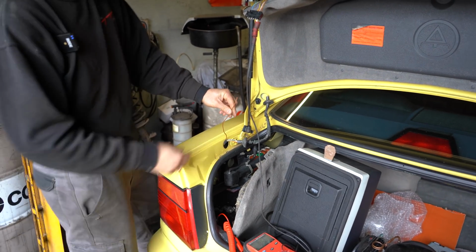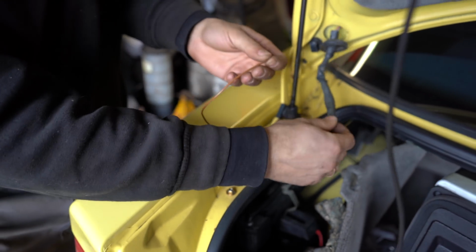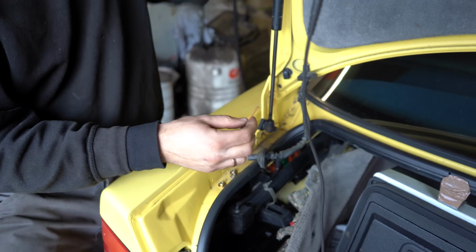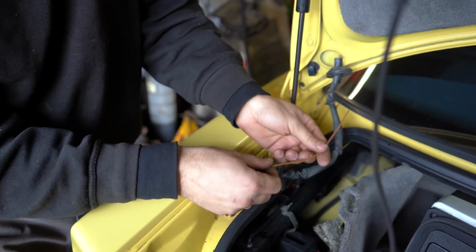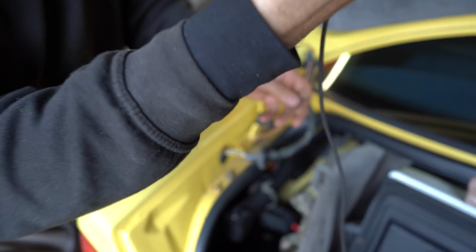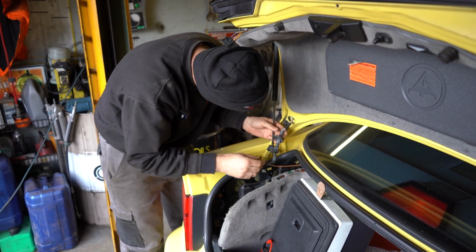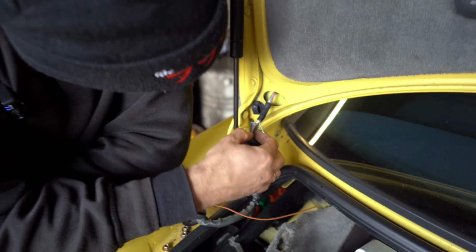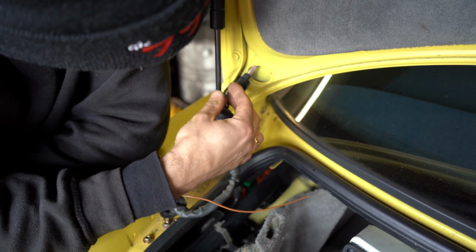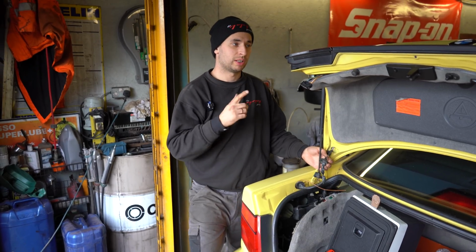Here it is. That was funny. I was wiggling the wires and everything seemed to be fine, but yeah, broken wire. So it was literally somewhere in between there. Easy fix then. Oh, there is more than one wire broken. Just thinking, how come it didn't catch on fire? Touching each other. But no big deal. So that rear fog light message was really bugging me. So now I gotta finally fix it.